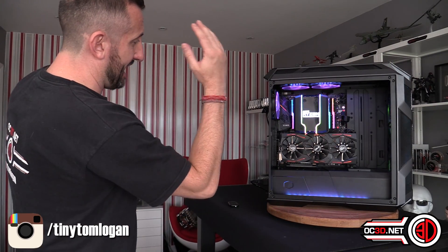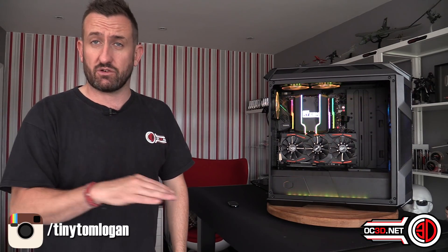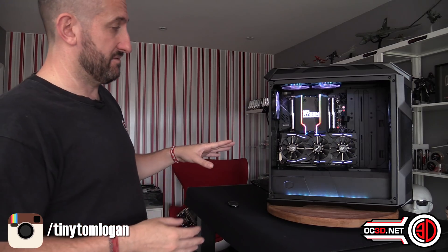So a really nice and easy way to show you how to get the GPU in there. People will say that with a lot of cases you're going to have those bars across the back. If you don't use the H500 series of cases, you can just use a Dremel to cut those tabs off. Or if you want to go really old school, you could use tin snips, but you'd need to file and clean the lines up. But this gives you an idea of how you can get around it.